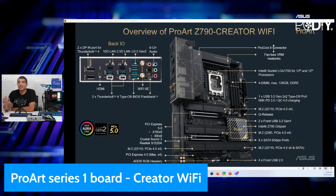But the big difference is if you take a look at the speed of those ports. One, there's no legacy USB 2 ports, and there's no 5 gigabit ports. These are all 10 gigabit ports. So that's one big upgrade that you're going to see compared to many of the other motherboards. The other thing, of course, is you're going to have two USB 4 or Thunderbolt 4 ports on this motherboard as well. Dual LAN, so 2.5 gig and 10G.